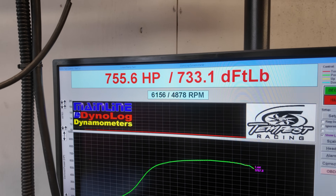We've obviously already done the timing and all that stuff — this is just fueling. That was perfect, except my stupid ass forgot to log it. I'm going to try three pounds of dome pressure — that's probably all it has left in it fuel wise. The power numbers it's making now are fine for what it is. And I think I'm going to build another custom table just for idle on ethanol because it's being a little bit goofy in terms of getting all the trims and stuff correct. But once we give it literally any throttle and start moving, everything is — I'm totally happy with.